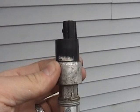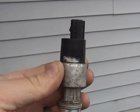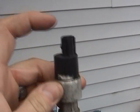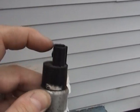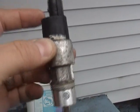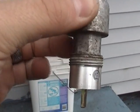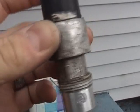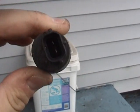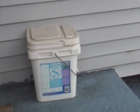Taking it out is really easy. First, you just disconnect the connector from the top — push in the little tab to release the electrical connector — then use a 17mm wrench on the hex fitting and spin it out counter-clockwise, and clockwise to install it. I don't know the exact torque, but you don't need a lot, so just use your best judgment.